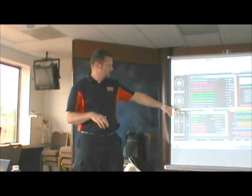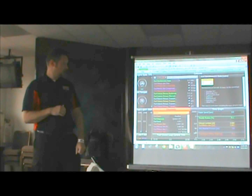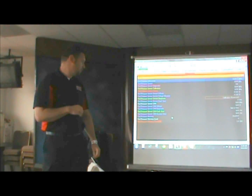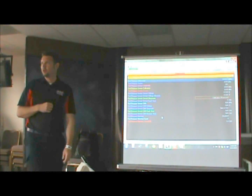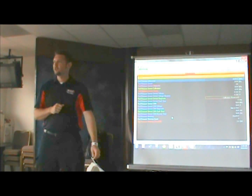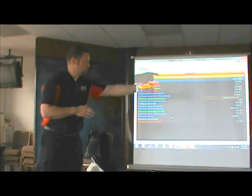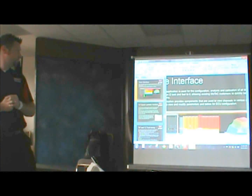And then if you go to channels, you go to fuel pressure, and F6. There you go. So now we can actually see what our raw voltage is, what it thinks that fuel pressure is right now, and it says 4.5 volts is the maximum measurement of most pressure sensors. So it's saying that we're reading a value that's higher than what the maximum of the sensor is, and you should expect that possibly this value is wrong. All right, let's go back to the presentation.